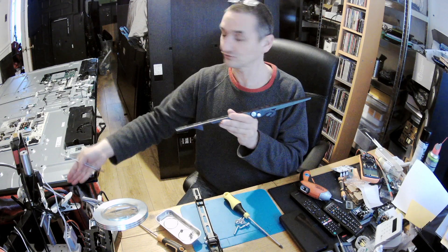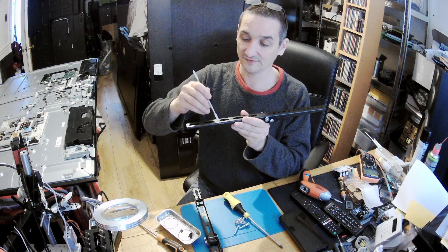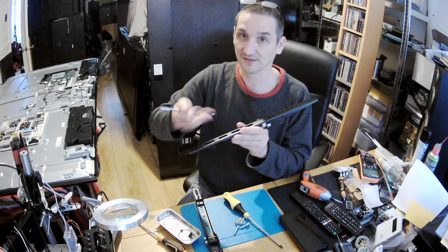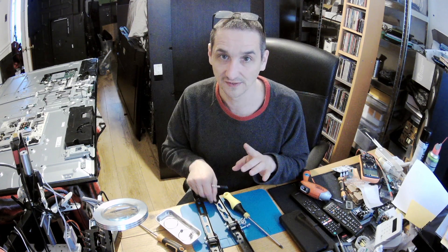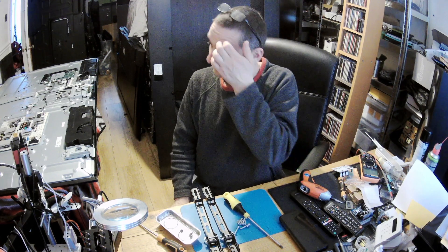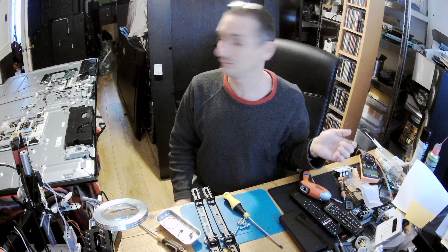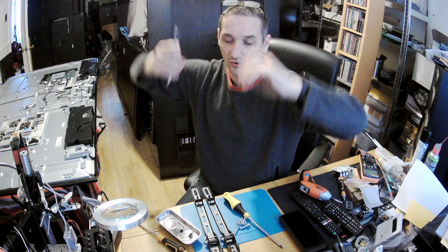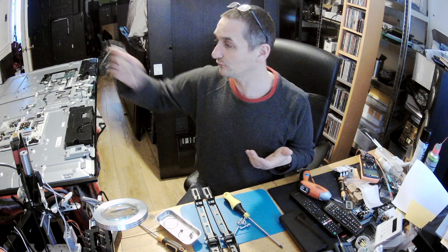Here is the plastic cover on the side — what you're doing is prying it, prying it, prying it, and it will start to pop out. Leave the top last. Because I've done a similar model in the past, I knew this might be similar. I did one side, then the second side. Once the sides and bottom were loose, I used a swing motion up to the top and this way it clicked off easily. I didn't damage anything — if I had tried to pry the top it could have damaged the clips because of the way they are designed.